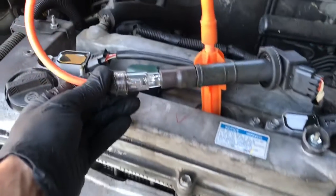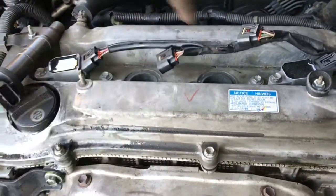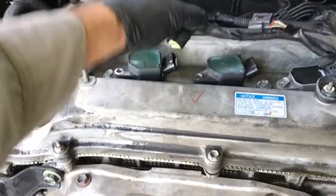These tools are only about $25 at most, and they're very handy for checking for spark. Another technique is to take one coil and swap it with a known good coil, and see if the problem switches.